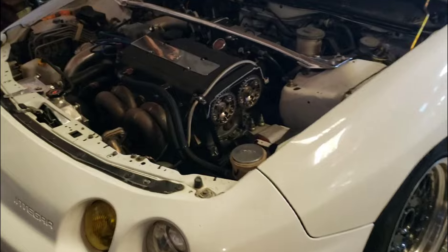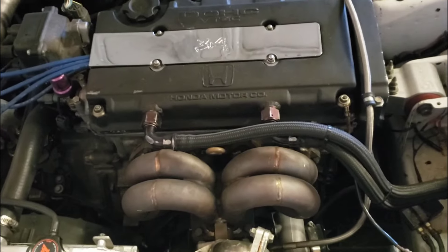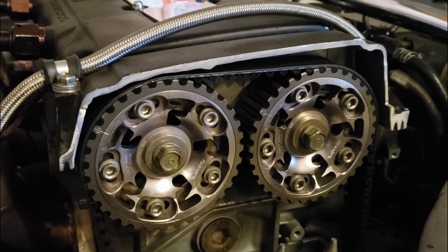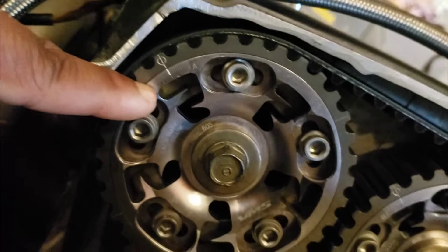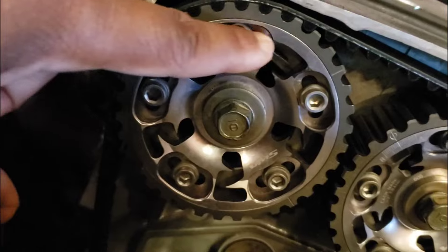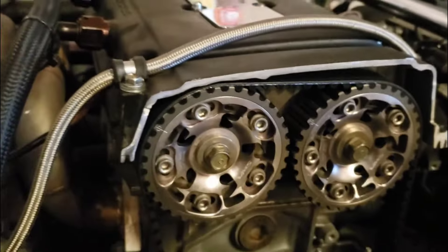I got the hood open and we're gonna start with the cam gears. Besides the cam gears, this engine has parts you can change for aftermarket stuff, and then you have stock stuff — this is a turbo engine. These are VMS cam gears, they're pretty decent. As you can see, the cam gears have numbers — R stands for retard, A stands for advanced. You loosen these allen bolts and you can adjust the cam degree. As you can see, this one is zeroed out, and that one is zeroed out as well.